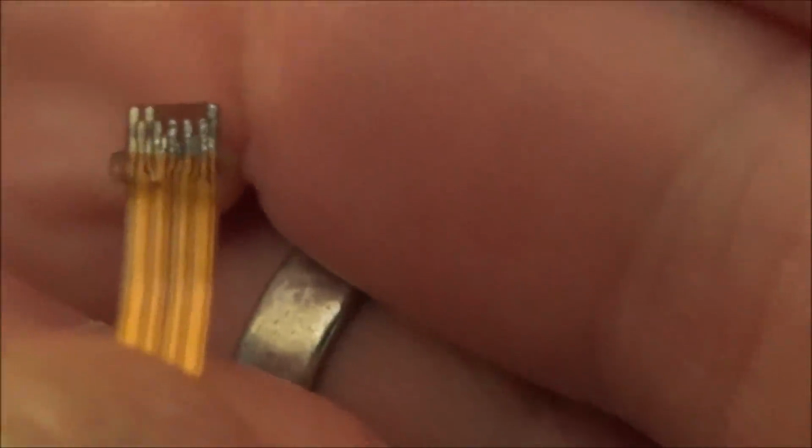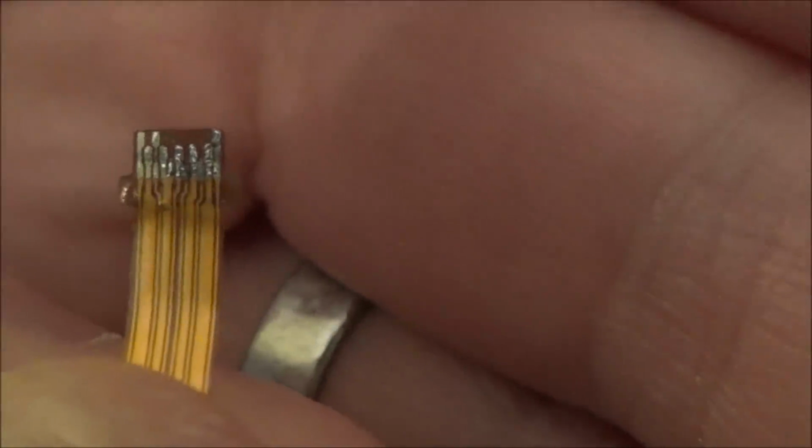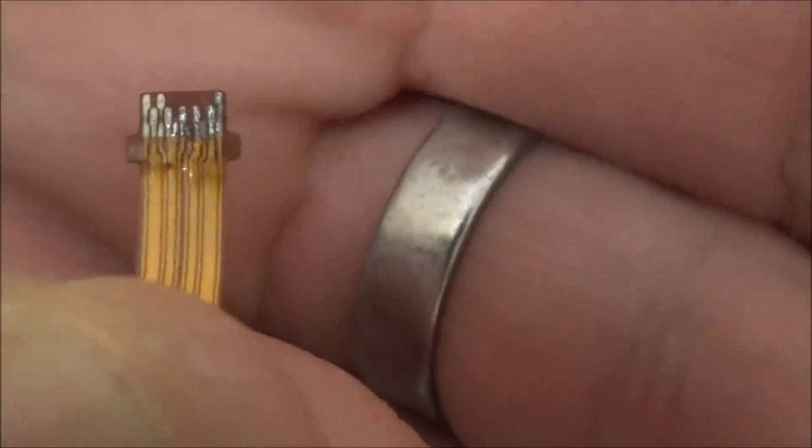There were basically tiny little breaks in this again, but because these ones were much thinner, the soldering iron wouldn't solder them, and solder was going in between two or three of them, and the more I tried to do it, I ended up just removing more and more of the actual contacts from the board there, and now this is useless, so I had to order up one of these.